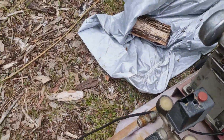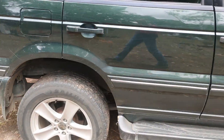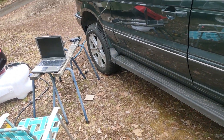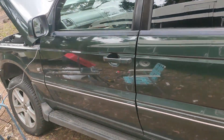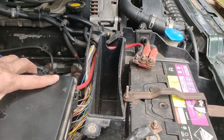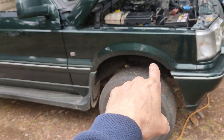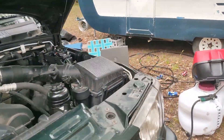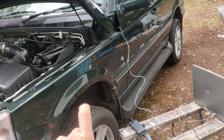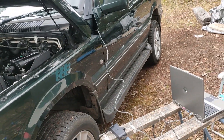Let's go with the compressor. I just shot the compressed air in and now I have this thing up really high. I got the computer, hit unlock on the EAS suite, and that's pretty much all I had to do. Then I unplugged it, went back, turned the car on, got my compressor, and put air into it — filled it up to its highest spot. Now I need to put under all four sides the little lengths of steel under the bump stops. Done that. I'll hook EAS suite back up, turn the system back on, and depressurise the airbags. That'll drop the car onto my wooden dowel inserts. Then I'll click get heights and enter whatever those figures are for the highest ride height.